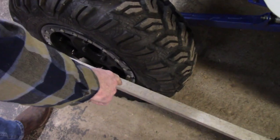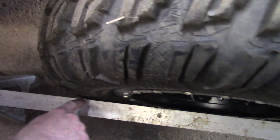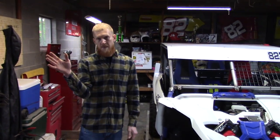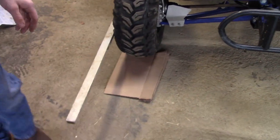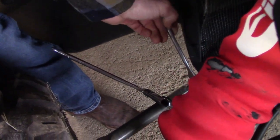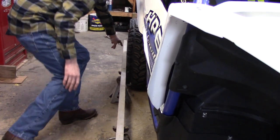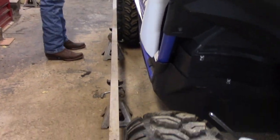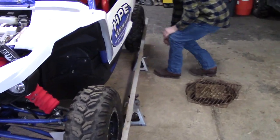What you're looking for is this tube touching the sidewall front to back on all the tires. Right now there's about a quarter-inch gap — it's not touching the front side of the sidewall on the back completely, but it is hitting the front. So the right front is toed out further than the right rear. We'll bust this loose, square it up, and pull the car forward onto the cardboard grease plates. I'm just splitting the difference to where there's the same gap front to back on the tire, then slide them in until the bar touches the sidewall of each tire all the way across.